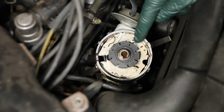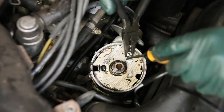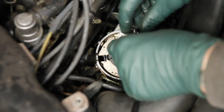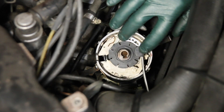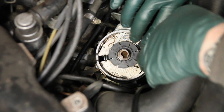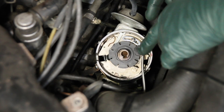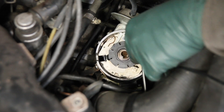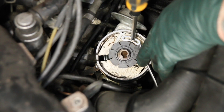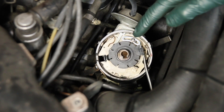After trial fitting the components, take it all apart and tighten all the screws. For the bracket screw, hold it with needle nose pliers while you tighten it. Now install the optical trigger — set it in position so the optical trigger light is just over the top of that slot. Once the height is right and the shutter rotates right in the center of the optical trigger, push it in and go ahead and tighten it down.